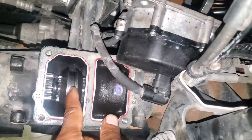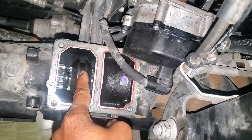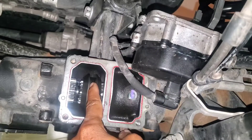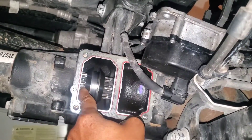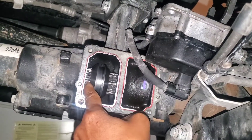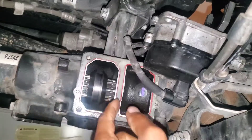Generally this fork will be over here on the outer axle shaft side when it's in two wheel drive. When you engage the switch in the truck to put the vehicle in four wheel drive, this piece right here will slide over and mesh with this inner axle shaft right here, and in return this piece and this piece will start spinning together — and that's how you get four wheel drive.